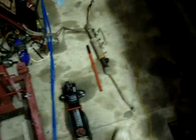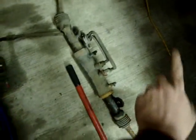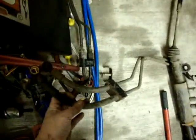This side is all done — well, we still got to pop out the thing, the bushing. We're off to remove the two 19 mil bolts to remove the rack. After you remove the two 19 millimeter bolts, this side here is facing the back of the car, and these two lines were what was left of the system. Here's the whole rack — I bet that's 10, 15 pounds at least, just that piece.